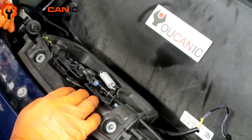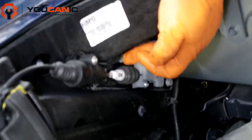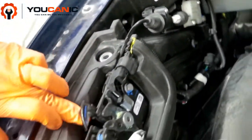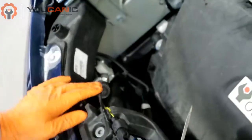The way that you would replace them: come here, you have an electrical connector — you're going to unplug that. Then you have a 10mm bolt there and one back here, plus a couple bolts here. Then you'll unhook the cable right here, take that out, and replace it. The same thing goes for the other side.